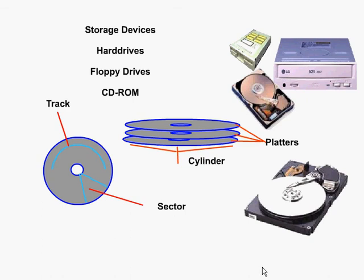Next we're going to talk about CD-ROMs. A typical CD-ROM can hold anywhere between 650 megabytes to 700 megabytes per disk. The technology used to read information is with pits and lands — the pits are indentations and the lands are what's between them — and this represents ones and zeros on your CD-ROM.